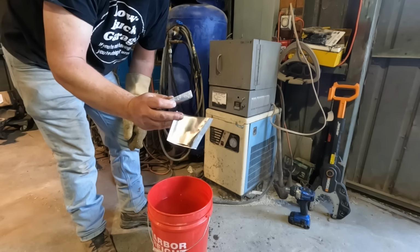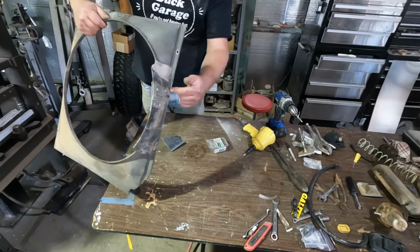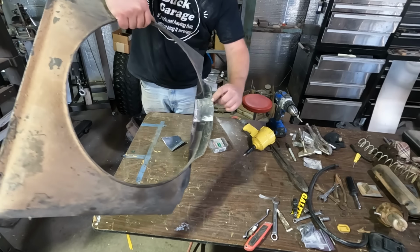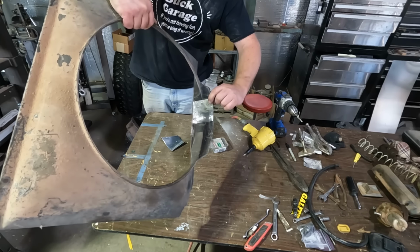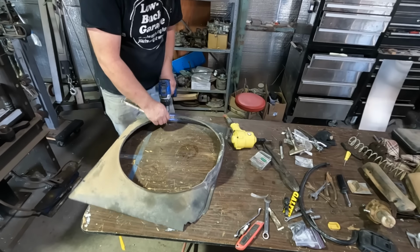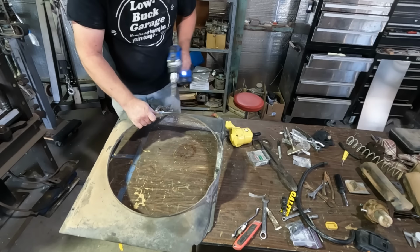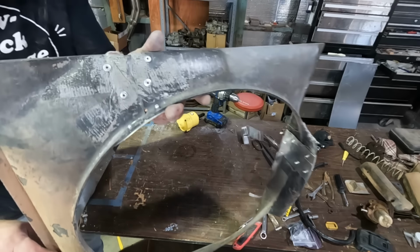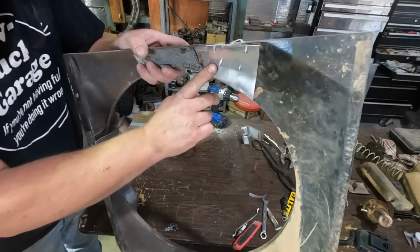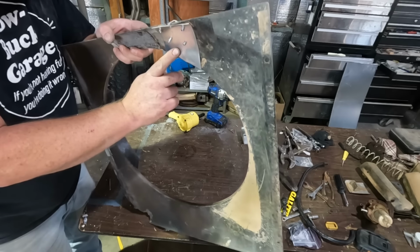It's nice and rigid. So now what I'm doing is I take my panels and I'm drilling through, putting a pop rivet with the big head on the plastic side and the upset head on the aluminum side. And there we are. We've got it riveted together. We got our form piece in there. Fits pretty nicely and a lot sturdier than it used to be with the duct tape.